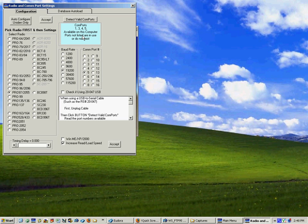So we unhook the cable and you should hear a small bing-bong from the Windows sound card. Then click the Detect Valid COM Ports button. You'll notice that COMs one, three, and four are now there and five has disappeared. Most likely that is the COM port that your cable is going to be using on your computer. So if you then follow the instructions and plug it back in again, you'll hear the familiar ding-dong of Windows, and if you click the same button again, back up comes number five.